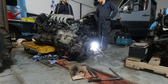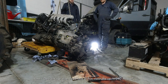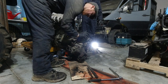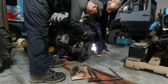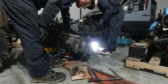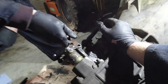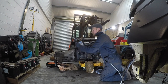So the source of the stiff gear change — I'm thinking it's this slider. It goes like that, and I'm not sure if that needs gearbox oil or just regular oil, but it has started to come up with no oil on it. This will be the thing that stiffens it up — it's all shit off the road. Selecting gears in the donor van was really difficult, the side-to-side action was super stiff. Since pulling it apart it's not the gear stick or the linkages, so it has to be this slider on the gearbox side. We're going to blow it out as best we can, glob it up with grease to loosen it up, then clean any excess off so future road dirt doesn't stick straight back in there.